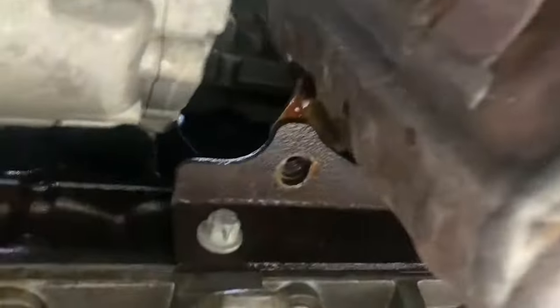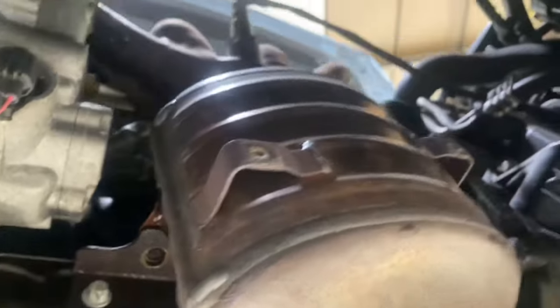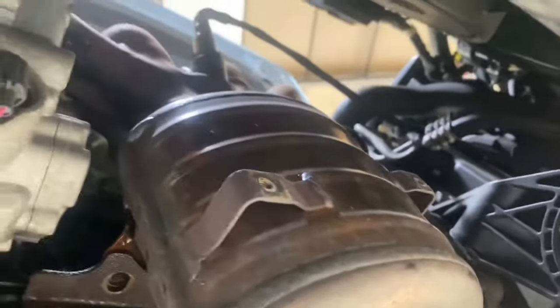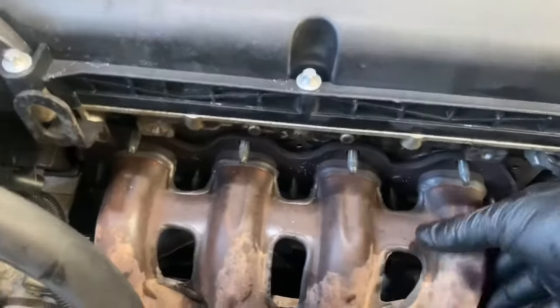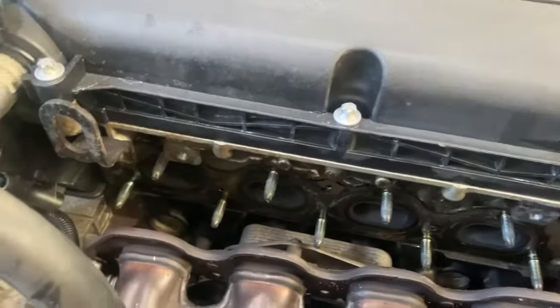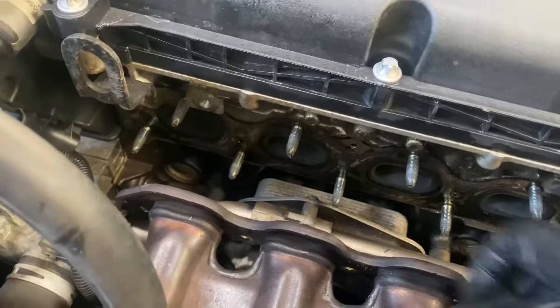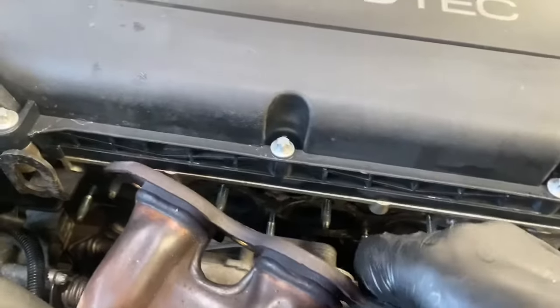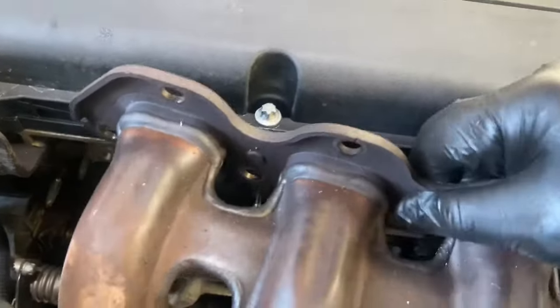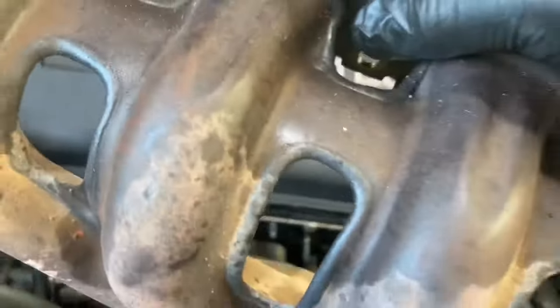You can see there are two of them and both are removed now. What we're going to do is go up top, disconnect the exhaust, and just take it out. We're going to slide the exhaust manifold away from the block just like so, and literally just pull it out gently - it's quite a snug fit.